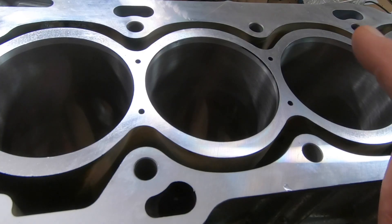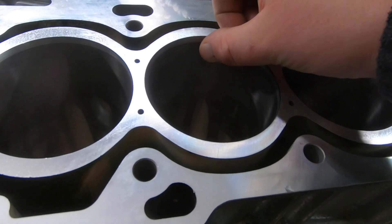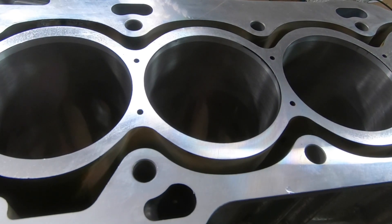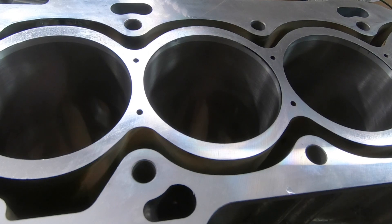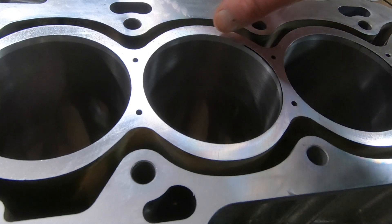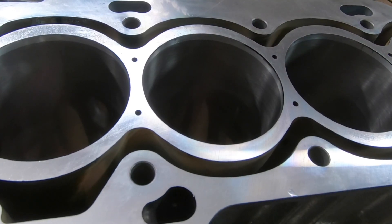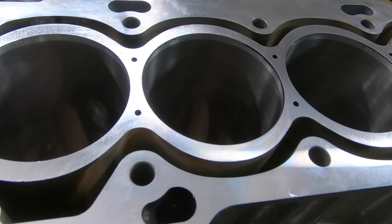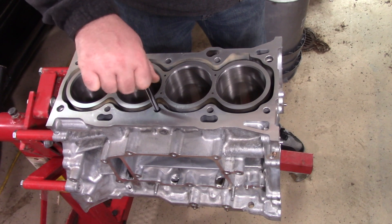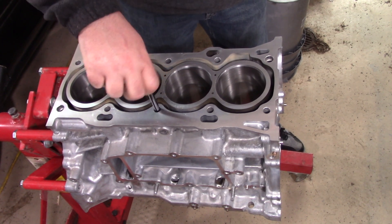The other interesting thing I hadn't seen when I first looked at it — if you look right in there, do you see how it's shinier at the top? The iron bore doesn't actually start until a little bit inside the bore; that's actually the aluminum showing. Nothing wrong with that. I just have to keep it in mind when making my custom pistons — I don't want the compression ring to go above that, but frankly it's so high up that it doesn't really matter. The number one compression ring would have ended up lower than that anyway. Now it took a bunch of digging, but I was able to find that ARP does have a head stud that'll work great for this. It isn't built for this application, but it'll work great.